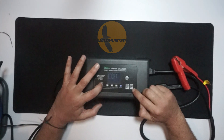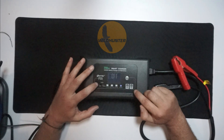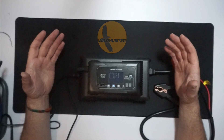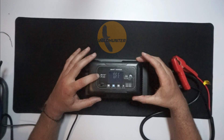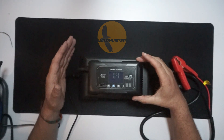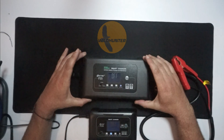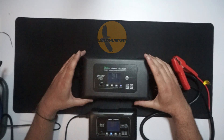You can vary the amps and slow it right down to a trickle charge, which will charge your battery slower if that's what you need. The P20 is just a smaller charger, and it charges with a max of 20 amps. So if you have a 100 amp battery, it's going to charge it in 5 hours from absolute empty — if your battery's half full, it'll take 2 and a half hours. These ones are less expensive and smaller, but if you want to charge your battery a lot faster, you can go with the P35. It's a one-stop charger for practically all 12 volt or 24 volt batteries on the market.